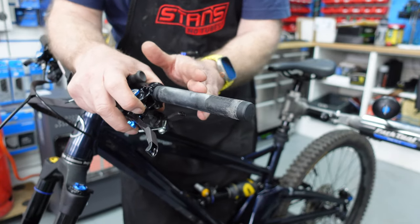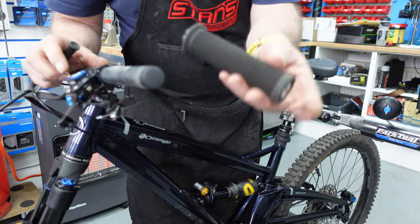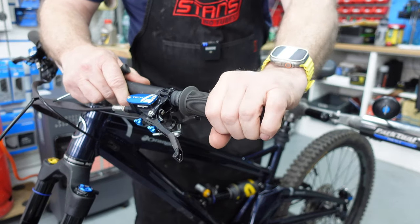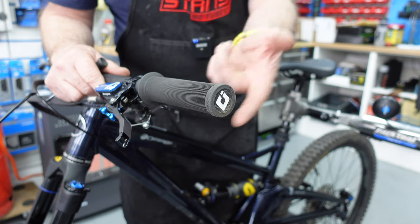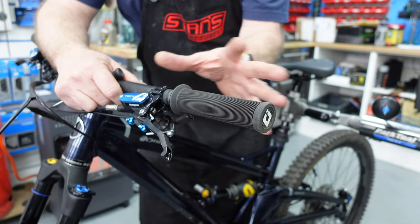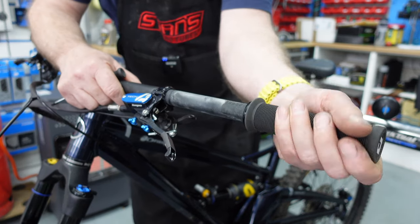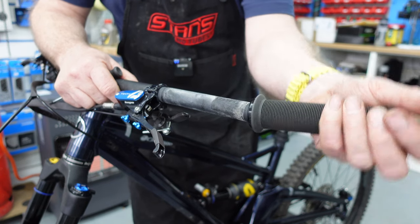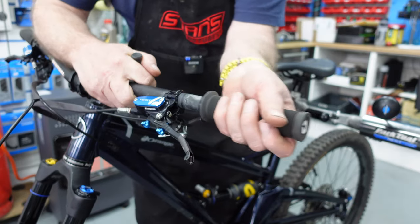Now the other thing we want to do is make sure this is completely concealed. By using these ODI grips on this particular bike that doesn't have a lock on that side, we can just slide these all the way over to the top, over the unit, and then it's completely hidden altogether. Because this is rubber and plastic, the unit will work really well behind that. You might also notice that this has made this side of the handlebar about 10 millimetres longer than the other side. So before you fit this unit, you might want to reduce the size of your handlebar by the depth of this particular unit, so that your handlebar is the same distance from centre to the outside on both sides.